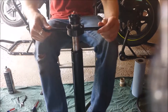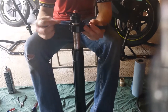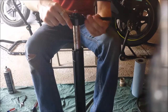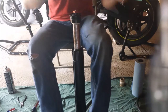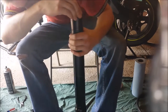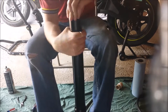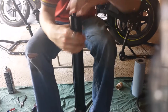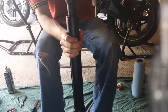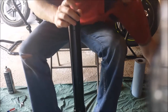Once you're happy with how everything is seated properly, go ahead and remove your tool. The last step: you'll lift the outer portion of the fork up to the cap, spinning it into place — be careful not to cross-thread it. Use your impact gun with a 32 millimeter impact socket and snug it down into place. Proper torque on the cap is 22 to 34 pounds of torque.